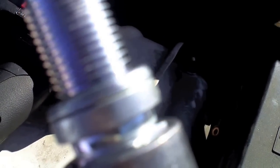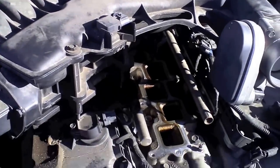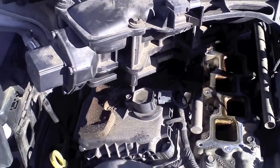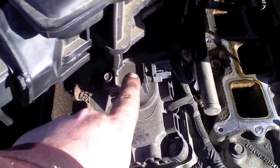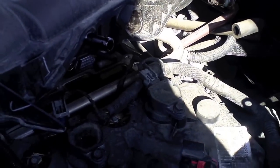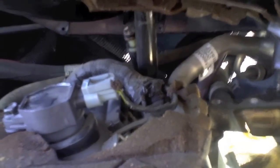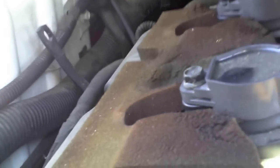Other Dodge products sometimes do not have a gasket - this one does, so make sure you get a good seal. I have four of them done now - these three over here and I just have two left. I had to turn the intake like this. It's not wanting to come out of the car because of the transmission dipstick - you can see it right there, that big pipe sticking up in the middle.